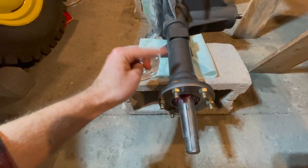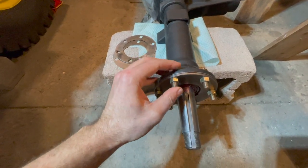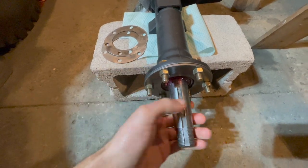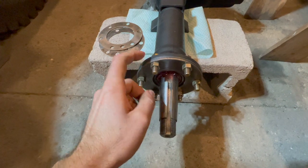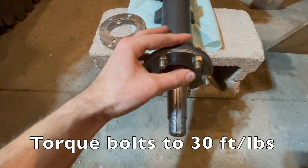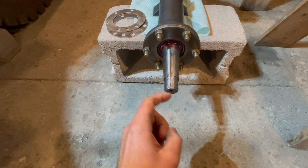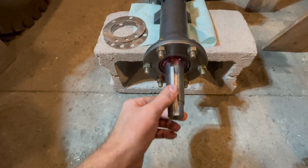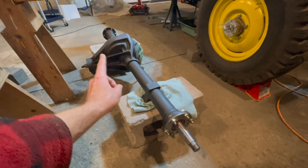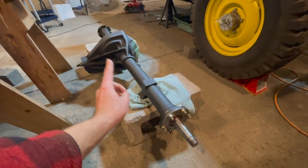Now it'll spin. More shims have been applied to your axle housing behind the retainer, and that has brought out the spacing — the axle shaft does spin now. Ensure you add the same amount of shims on both the passenger and driver side. Finally, you have to torque all 6 bolts to 30 foot-pounds before we mount a dial indicator to the end of the axle shaft to test the end play in and out, making sure it's in spec range between 1 thousandths and 6 thousandths of an inch.